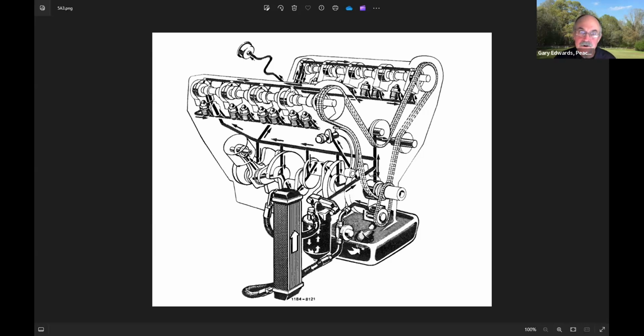And these parts are probably $15. I mean, they're really cheap, and replacing them is really easy. And Kent Bergsma provides you a step-by-step on how to do that in there. So that's one of the really important points here. You've got to know how old your cam oiler tube plastic pieces are, and you've got to know how old your upper timing chain guides are.